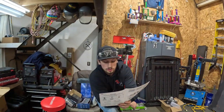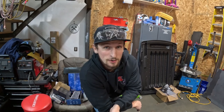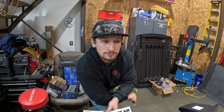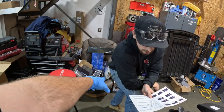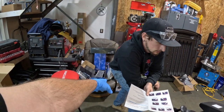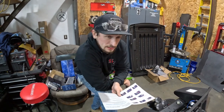A bunch of stuff has gone on since we last talked. You can change the fuses to whatever amperage you need, but you can only have a max of 60 amps powered at a time. We should be under that. We need to figure out how many amps those heated seats take. For some reason, I feel like that's a lot. There's so many inline fuses. There's another inline on the heated seats harness, and the headlight harness.